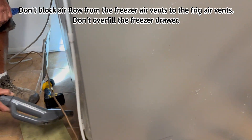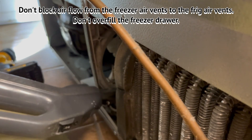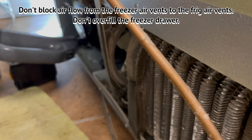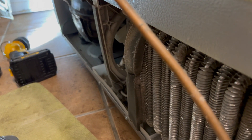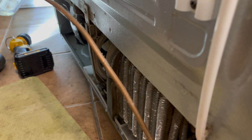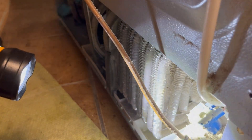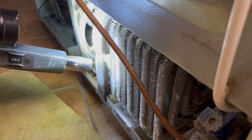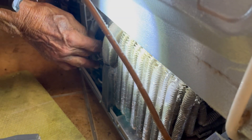You want to be sure you're not blocking any of the airflow into the freezer, back and forth, because you need that airflow. There are vents in the freezer that you can't block. I probably had them blocked. It seems there was water in the pan in the back, and there's a tube — it could be that the tube going down into the pan was maybe clogged. I'm not really sure.